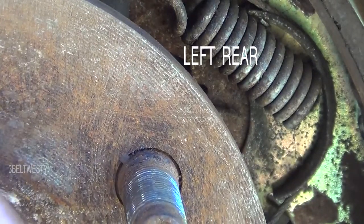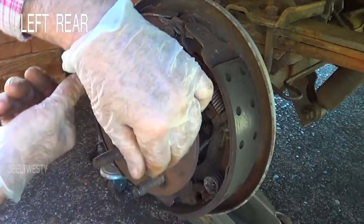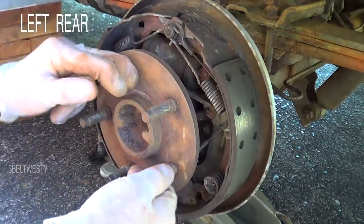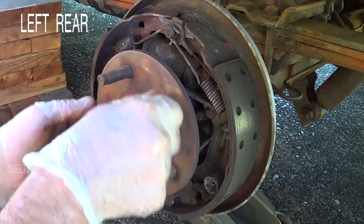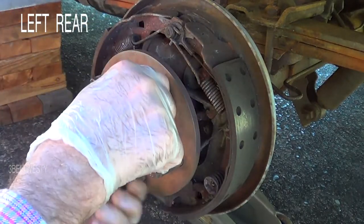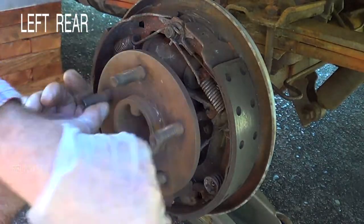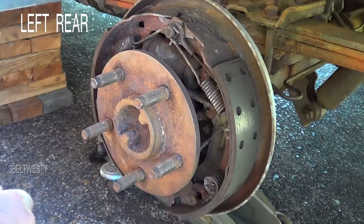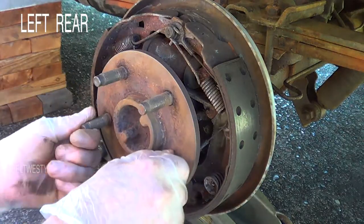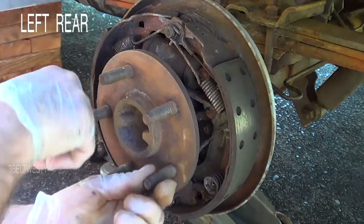The worn-out one is covered in another video. It doesn't have the horrible sound that the rollers are making on the other side. I can turn this both ways — car is in neutral, transmission in neutral, parking brake off. Over here is a big block so I don't get smashed. I've got a jack up underneath the axle tube — be careful working under a car.